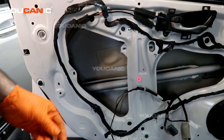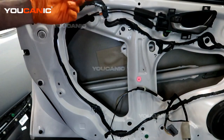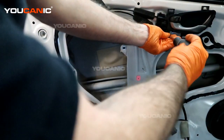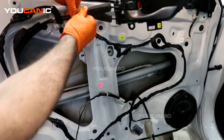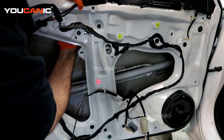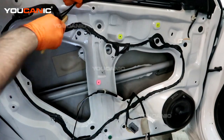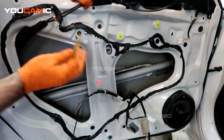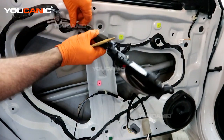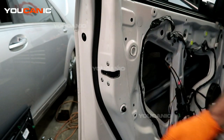So we have that flexibility. We undo these two Phillips bolts that hold the handle on up here, because we need to pull this whole unit out. We pop a little squeeze clip. Then we just need to pop this little tab up and pull these wires out and let those hang down there. Then we need to undo the three bolts here — they're a T30.